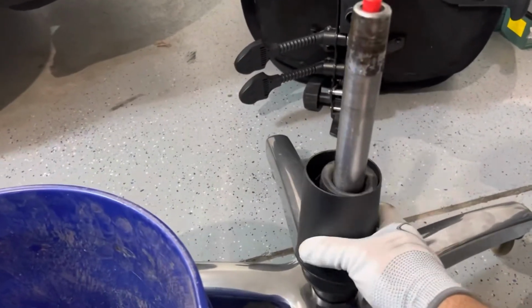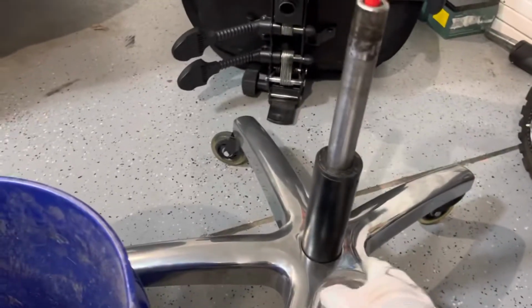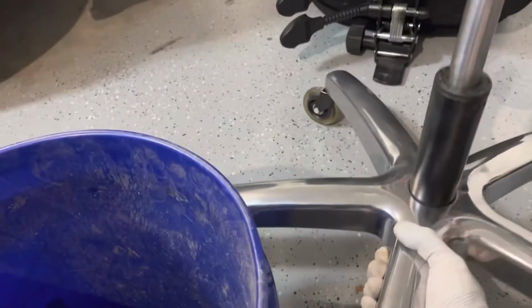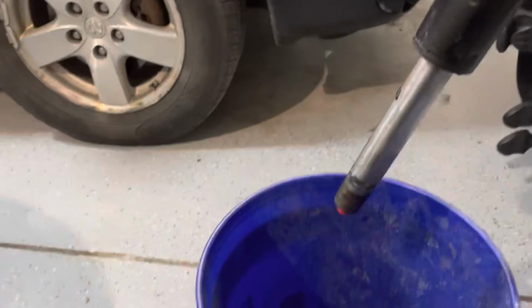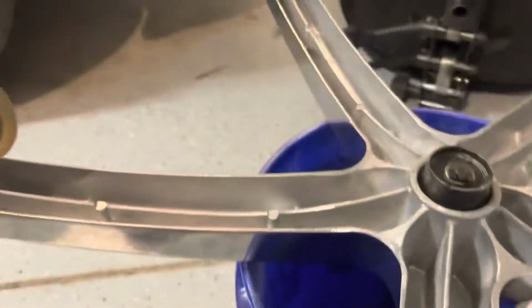Okay, so I've taken off the rings. I'm gonna hang on to those things for future chair maintenance, but I'm gonna slide off these plastic collars. We don't need these anymore, or at least not for this cylinder. I'll set those aside. So now I have, here's the old cylinder in this 2-inch base, which is standard size. I need to get this out of here. I'm gonna turn it upside down into this 5-gallon bucket, which gives me a couple inches of clearance at the bottom.